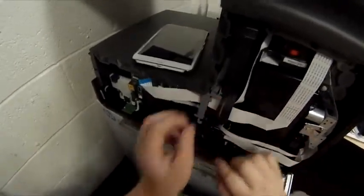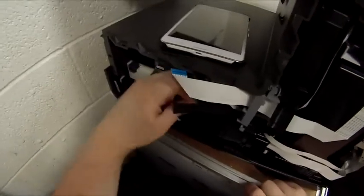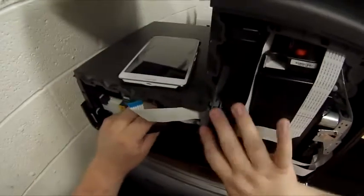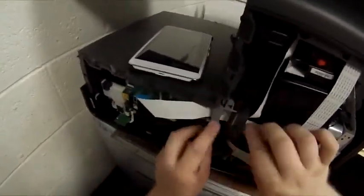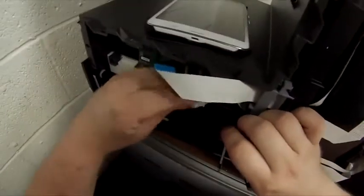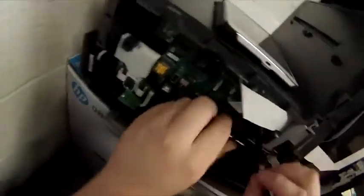So I'm going to put that in. I'm going to put this retainer clip back in place, I think, after I latch the easy ones, in case I have to move anything. That large connector I don't usually put in until after that's screwed together because it's a zero insertion force connector. So you put it in and there's a little lever you push down. And if you were to yank on that cable with it locked, you'll break the lock. And then the cable won't seat and it won't work. And you'll need a new controller board there. I guess they would call that a main board.